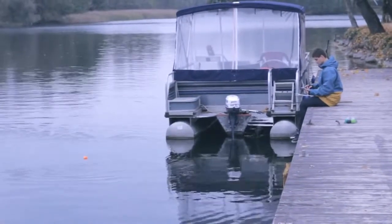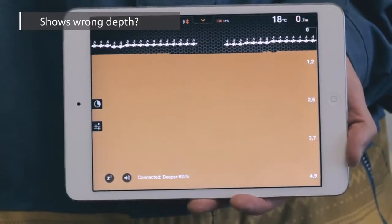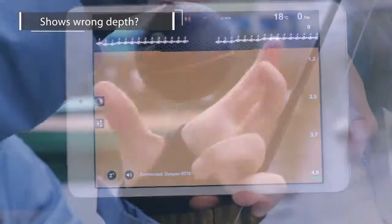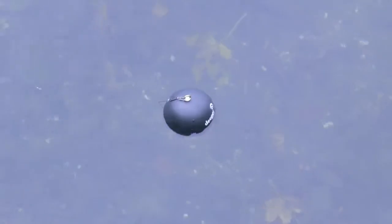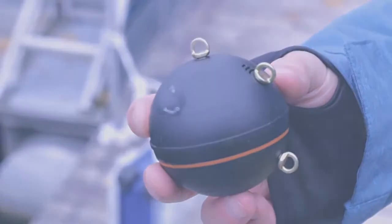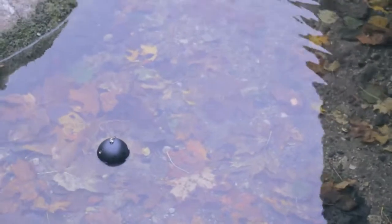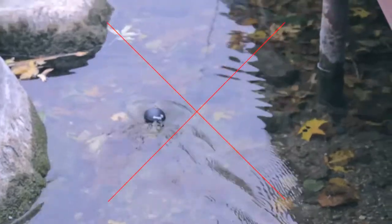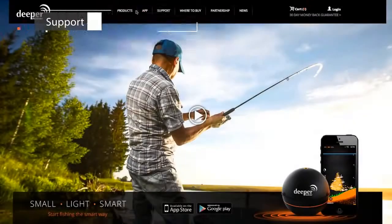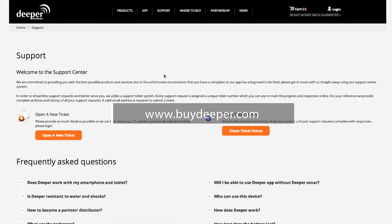Can't reconnect: to reconnect, the Bluetooth device must be as close as possible — maximum 40 feet. Deeper shows the wrong depth only with inappropriate usage. For example, when you reel in Deeper attached to the wrong attachment bolt and the signal does not point straight down. You should not screw in all three attachment bolts at the same time — doing this makes Deeper unstable and the transducer beam will not be directed straight down. If you use Deeper in very shallow waters such as one foot, the signal reflections will be too strong. If you need additional information, please find it at our official website BuyDeeper.com, or write us at support.BuyDeeper.com. We'll be happy to answer any inquiry.